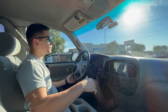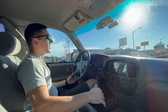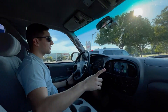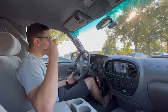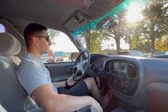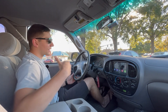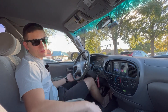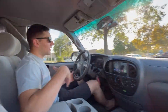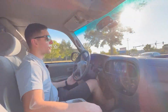The big question is, does it drone? In my opinion, it doesn't drone at all. Yes, it's louder — there's more engine noise, that's what a new exhaust does. But I've been in droney cars. The 240 before I put a new exhaust on it was super droney. My brother's Lancer in high school was very droney. Drone is just that humming in your head that you just can't get out — it's deafening and you can't even hear yourself think. It's brutal. But this doesn't have it. I think it really helps that the exhaust dumps so far behind the cab, like it's way back at the end of the bed. So if it dumped under here, yes, it would probably be droney. When people just cut off their exhausts, it makes sense that they have a lot of drone. But being all the way back there, it still has a muffler — it's not a straight pipe or anything like that. Heck, it still has a resonator too. So I think that's key for not having any drone.